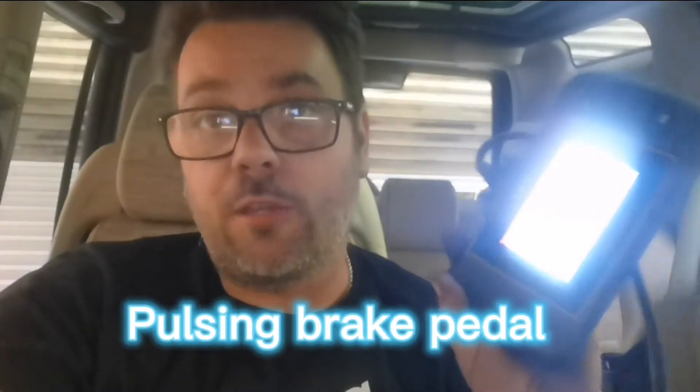Hello, welcome to the channel today. Just a quick one — we're still on the Discovery Wimbledon Green Adventurer. We were about to take it for the MOT, we've done absolutely everything, but when we weren't taking it for a test drive, the ABS keeps coming on on one of the wheels, but there's no code showing on the code reader, so I was unsure what it was.